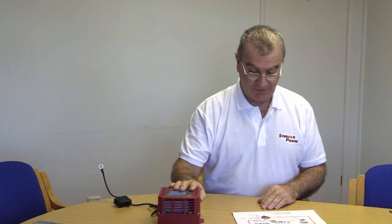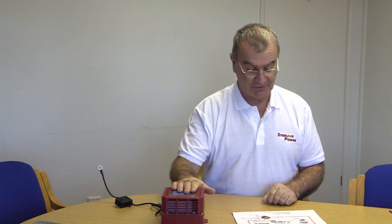By doing this you can fit things like inverters — wild-side camping people often put an inverter on for hair dryers and similar. You can comfortably fit an inverter, then just switch your engine on for an hour in the morning — that will heat your hot water, boost charge into the batteries, giving you 120 to 160 amps into your battery bank. Probably half an hour in the morning will do the job. That's really how you fit the battery-to-battery charger — it's quite simple, very effective, increasing your charging from about 15 amps to, in this case, 120 amps.